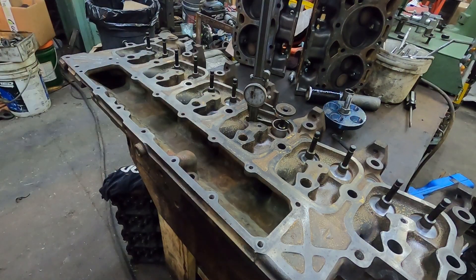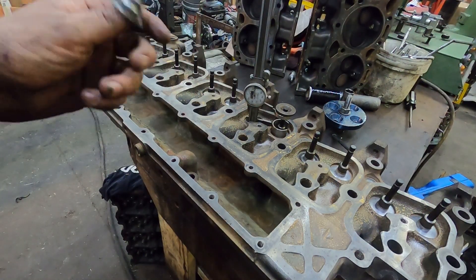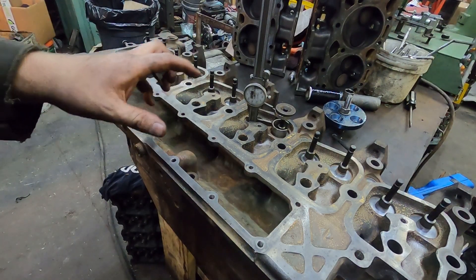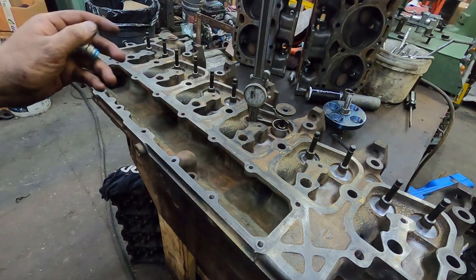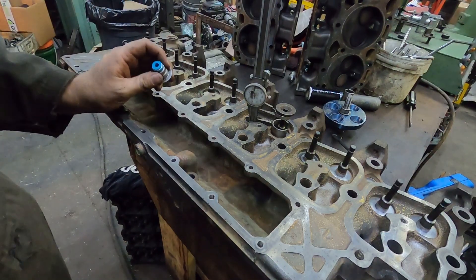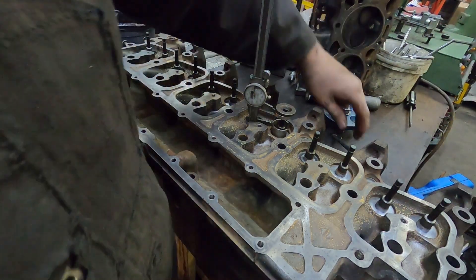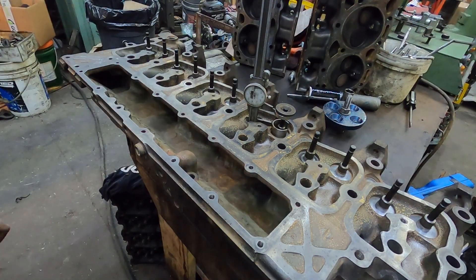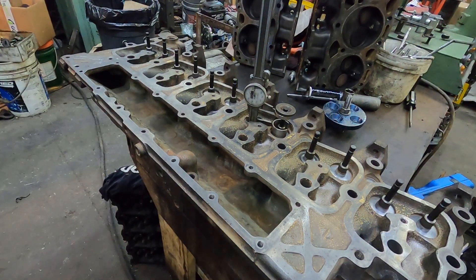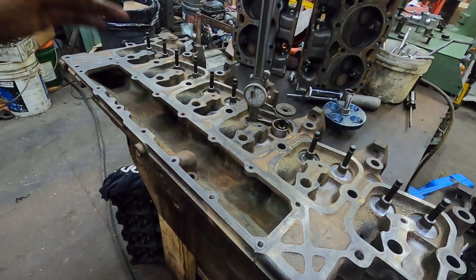If you're having a head built by somebody, make sure you tell them what camshaft you're using with the lift. Lots of times, being that I only cut a little bit out of these seats and didn't get carried away, and I use new valves - that's the reason we're still within spec. As these things wear and the seats get in there higher, that stuff changes. Just something to take into consideration. I'm not sure if I'm going to put a stock cam in it or use a little bit better cam. I'll keep you guys apprised of that - but nothing that's going to hit coil bind on a 60-pound spring, which is still a stock spring for a marine application or industrial use.